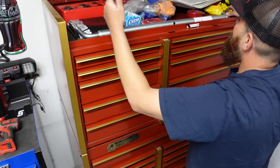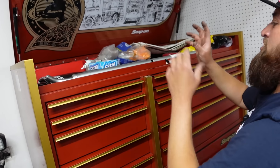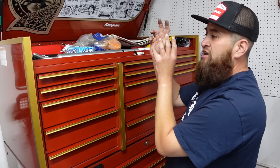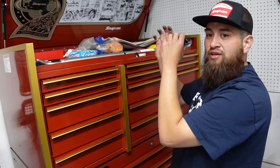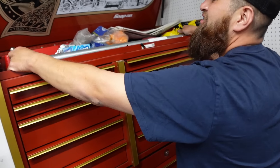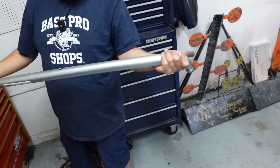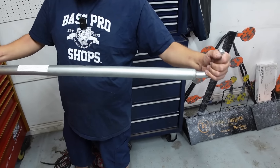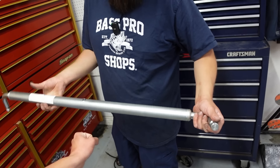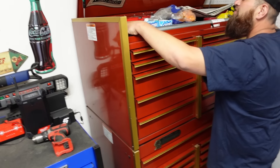I didn't know they made that tool. So on the lower control arms, on the inner part where they bolt up to the vehicle it's slotted but there are no eccentrics for adjustment. You loosen it and with this you push or pull it to where you want, because the tool telescopes in and out. Wow, that's cool.